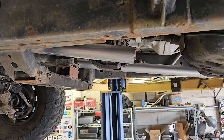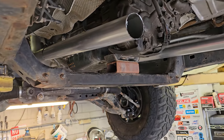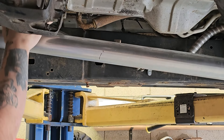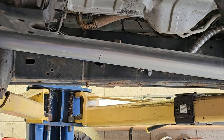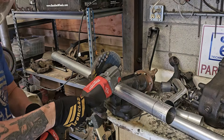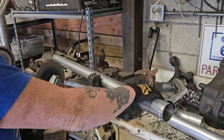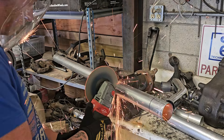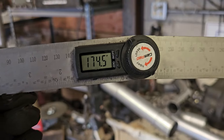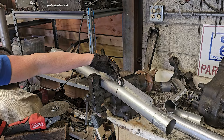Now it's time to start cutting up that two-and-a-half inch Flash Arc exhaust pipe. The pipes are diving down and that bugs me. I thought I had the angle perfect but apparently not. I'm going to cut a slit, bend it, and weld it to get the right angle. I'm lining the bottom up with the frame and the top up with the pipe — five and a half degrees. I subtracted that 5.5 degrees from 180 to get the angle I need: 174.5 degrees. It actually looks perfect.